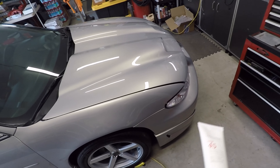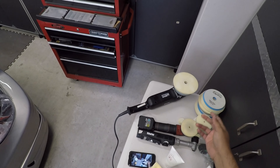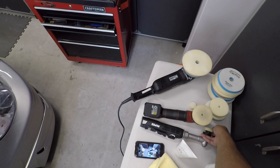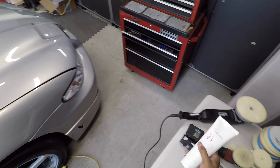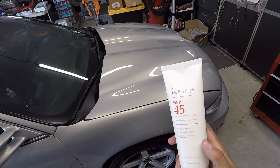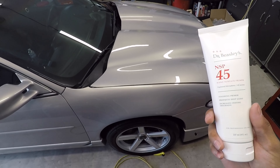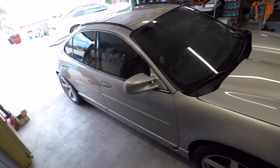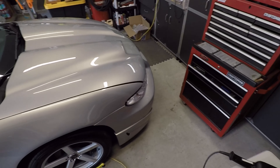Again, that's NSP 45 — how hard your paint is will determine usage. You can possibly get away with using it on a polishing pad. I'm using CarPro gloss pads, but any foam finishing pad will do — for example, on the Rupes Nano I have a Rupes white pad. NSP 45 is a finishing primer that creates an anchor for your ceramic coating or coating of choice. I'll go around the car and give my final thoughts once I've done the entire car, and we'll see if there's an increase in gloss.